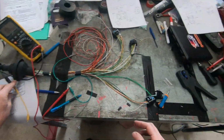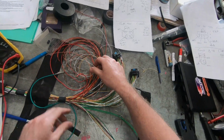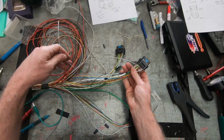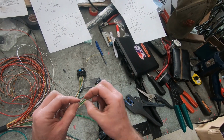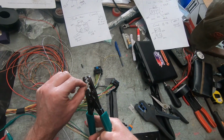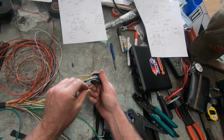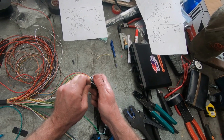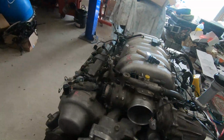So the clutch will be turned on to a PWM, pulse width modulation, and that'll just keep that clutch for that throttle working like it should. Goes to the A plug. The other side will go to a 12 volt supply. Rightio, we're moving along quite well.